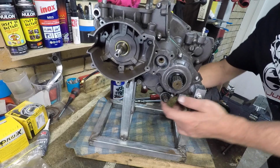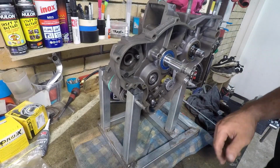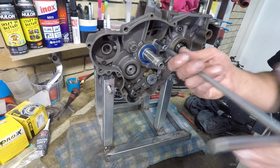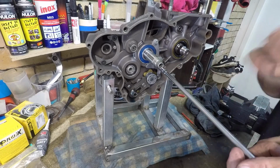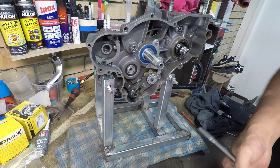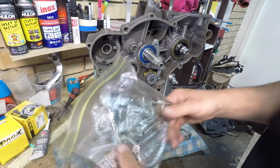Alright, there's the shaft that the gear shift lever attaches to. That was all that sorcery, right? Okay, I have a bearing retainer. Okay, so after this it will be idle gear, kickstarter, main drive, and then that clutch basket assembly. Nice and tight. Tight lines. Still double check that one. That's good as well. We'll just double check. From what I know, that's correct. Alright, another bag done.